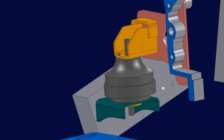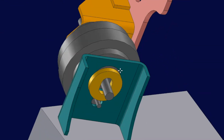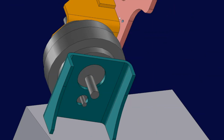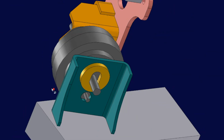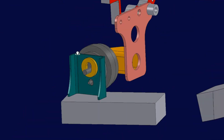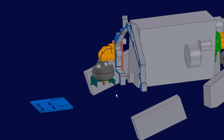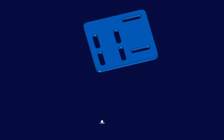Now, we are going to make the motor mounts fit a little bit better than it would have in the Volkswagen that it came out of. There's a lot more heavy duty steel involved with our mounts, and the motor that we're bolting to the transmission is a lot smaller than the original motor that would have come in front of our transmission. So our transmission actually weighs more than our engine. So as long as we brace everything really well, we shouldn't have any issues, and we'll see as we drive this car if we have to do any adjustments.